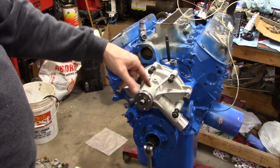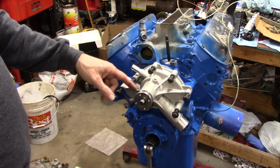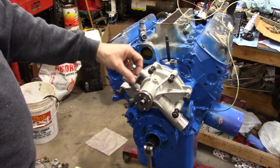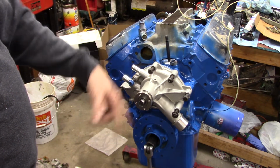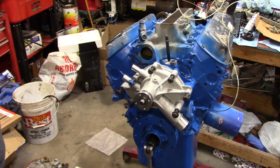I have more oil because I'm a quart low. I think I told you that. I've got 4 quarts in it. It really needs 5. And then what I may do is tilt this engine just a tad so the oil doesn't keep running out on the floor. And then I may go ahead and spin this up again and make sure it's spinning the engine at the same time, and try to make sure that that's completely lubed. Make sure that I'm getting lube everywhere.